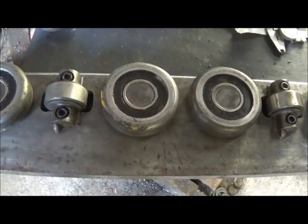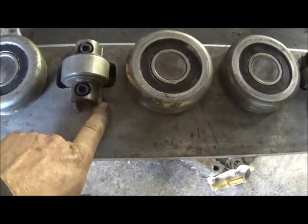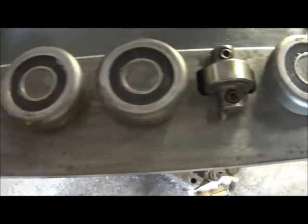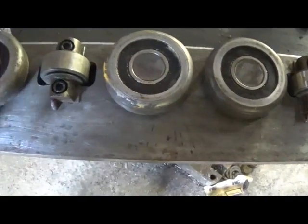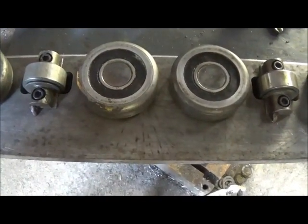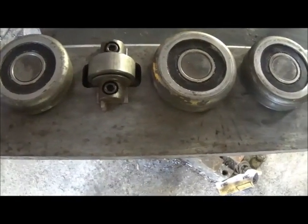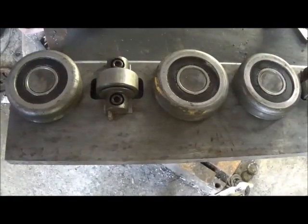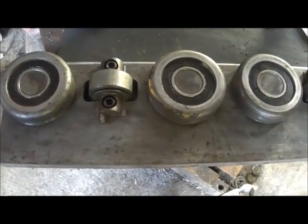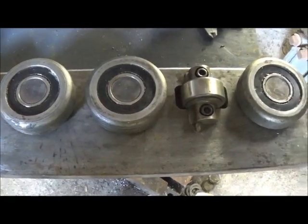Not much different than any other day — I've run out of time again. I didn't get as far as I'd like, but I did get all these shimmed where I want them. You can see the shims up under here — I've got them exactly where they need to be. Got the oil tubes in both of these ones. The other one, I just have to machine my groove in it. I've got them all welded in now, still have to weld the other one. But this one is ready to go — really nothing else to do on it besides get it in place, get everything lined up, and start welding the top plate and gussets onto it. We're going to call it quits for now and be back on it as soon as I can. Appreciate you watching, subscribing, commenting, liking — till next time, bye.